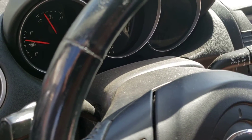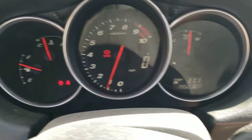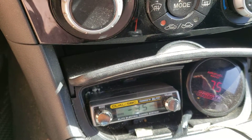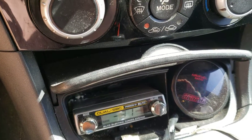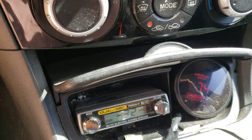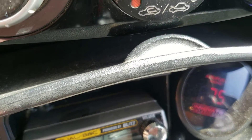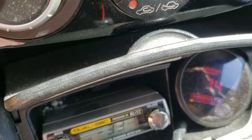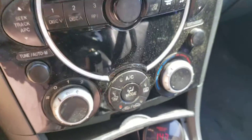You've got to wait to rev it until the air-fuel meter registers. It's still not registering yet. It'll be like 14.7, which is the normal AFR the car likes to run at, and then it should drop down around the 12s when we get into boost. Now it went up to 14 — yeah, there it is.